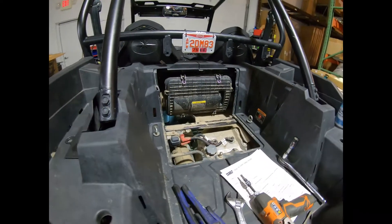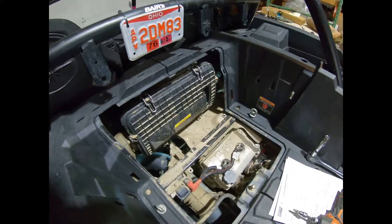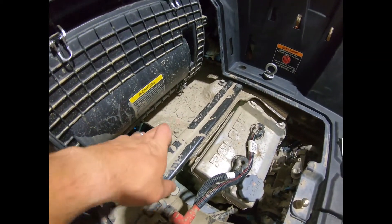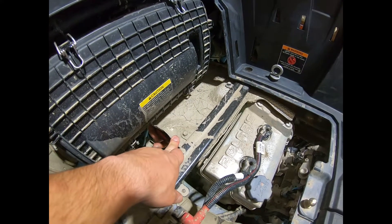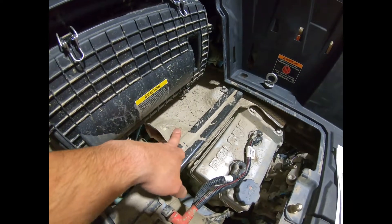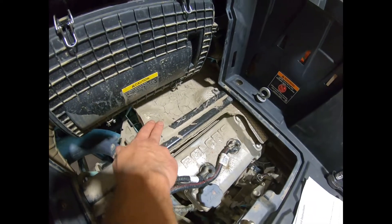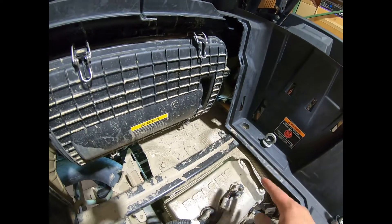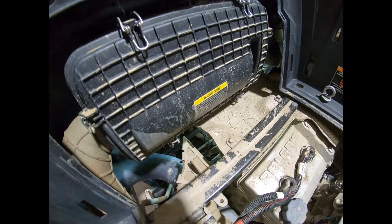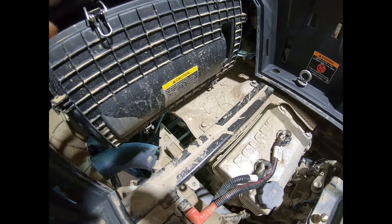So this is a little update. Ran into a little bit of an issue trying to get the top mounting hardware off — you're going to have to go ahead and remove this heat shield. It doesn't talk about it specifically in the instructions, but you'll definitely need to remove this. It's three 10 millimeter bolts — one here, one here, and one on the outside that connects to the heat shield over there. And then there are two plastic rivets up front. Once you remove that, you'll have direct access to the top mounting hardware.